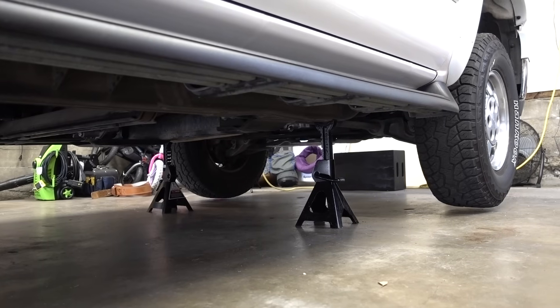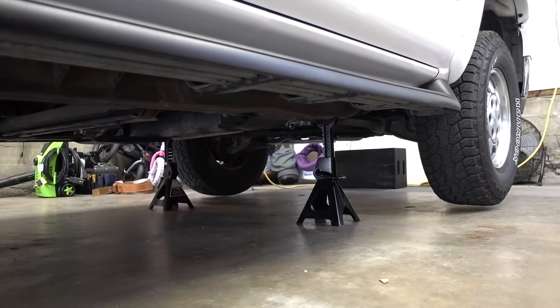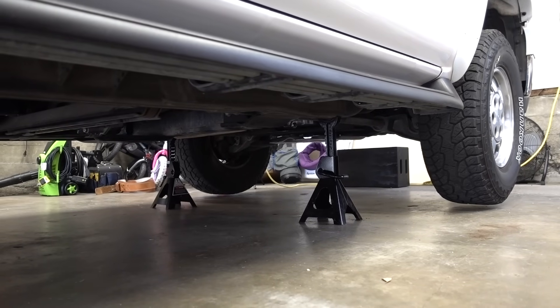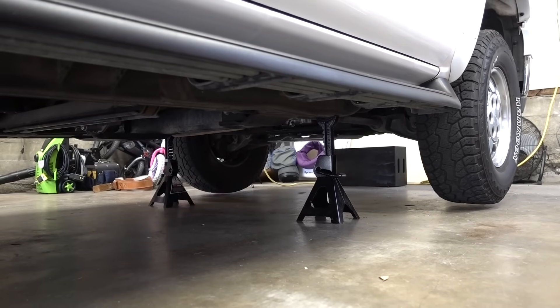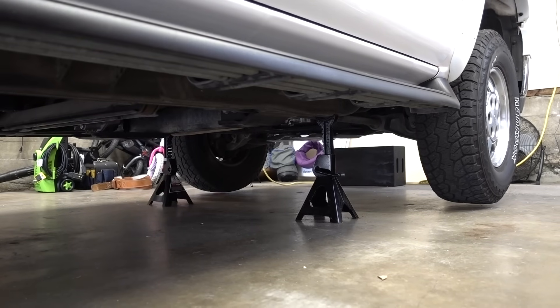You may also want to put your vehicle up on jack stands as I've done. What this does is gets your tires off of the ground so we can attempt to pump out the old power steering fluid just by turning the steering wheel without having the motor running.